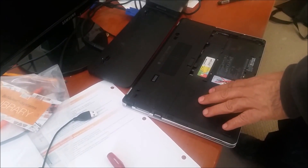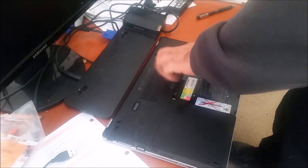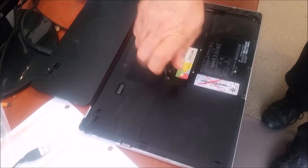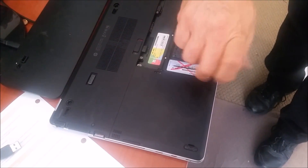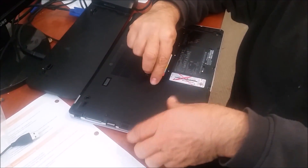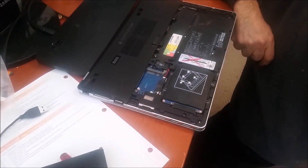There are two back panels here that we need to remove if we want to replace something. You can see this left panel and this back panel. There are two screws that I need to release — they will never fully remove, they will just be released. This is one and this is the second one. After you release these two screws, you just press it here to the left side and then it will be removed. As you can see, these two screws are left here on this cover.